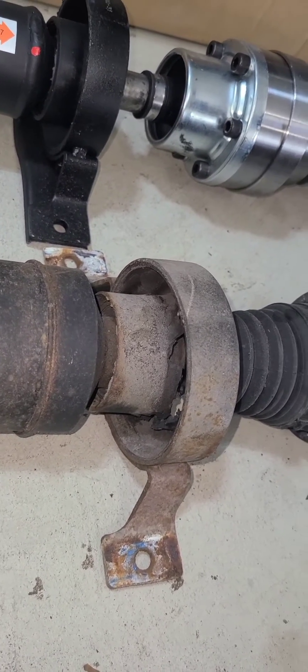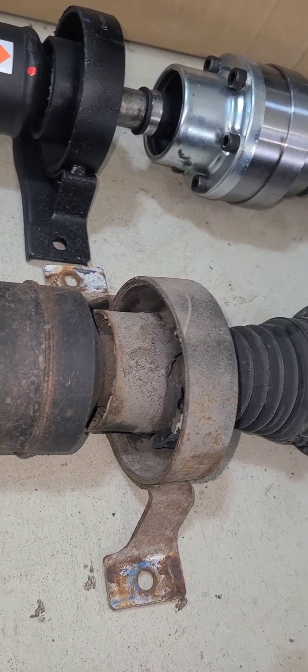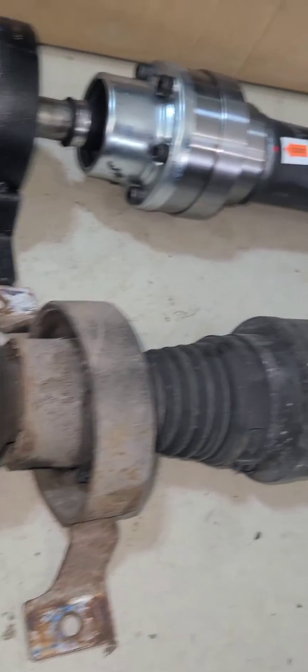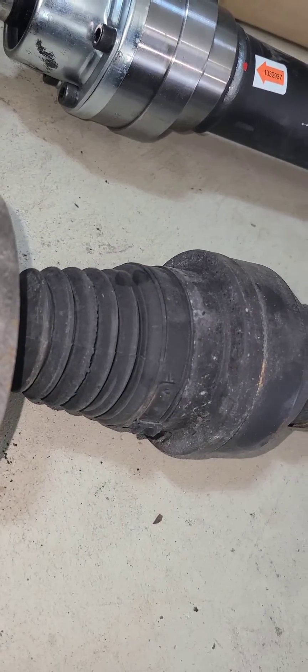The car had a really nasty vibration upon braking — it really wasn't evident anywhere else. I'm gonna say the drive shaft probably just bottoms out at the lowest point and doesn't give you a whole lot of harmonics until you try to brake or load it up.